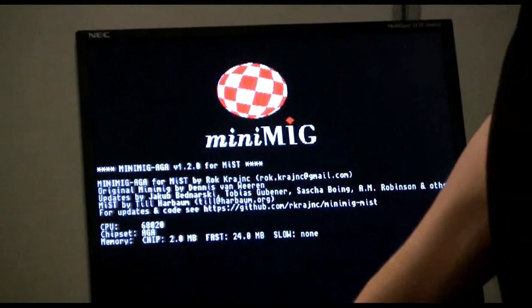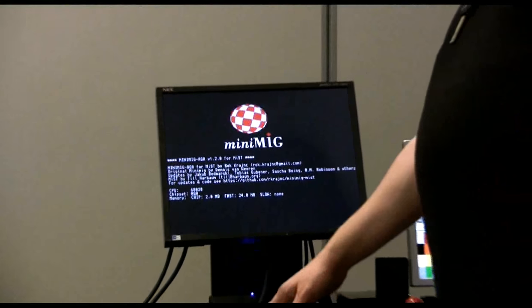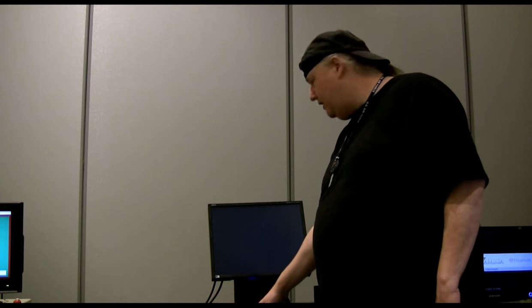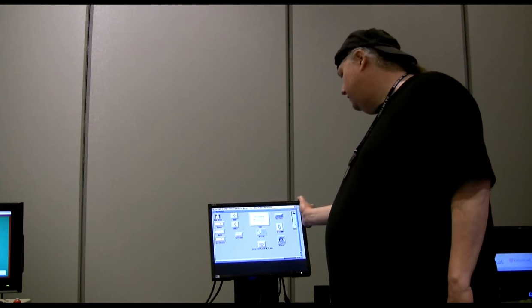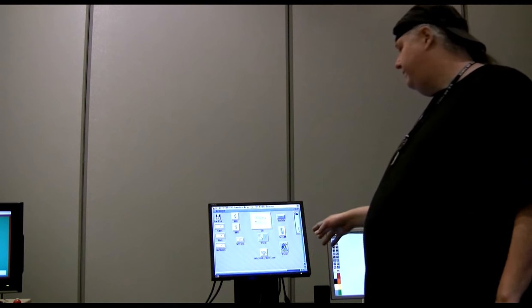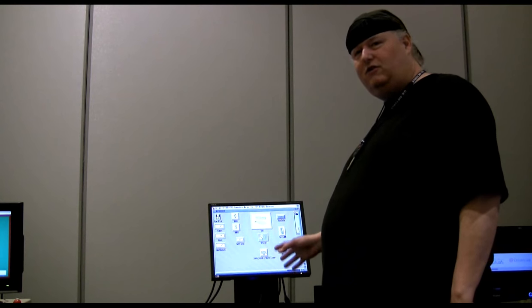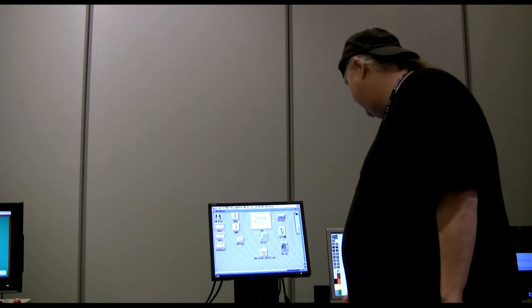This thing has an 18-bit decoder, so it's not quite full 24-bit, but what they've done is some sort of translation to translate the 24-bit Amiga 1200 and Amiga 4000 AGA stuff to 18-bit, so it'll run on here. It'll do the HAM8 modes and all that. So there's a slight color reduction. It's not quite 24-bit, but I haven't really noticed it. It's so close that it doesn't seem to be a big deal.